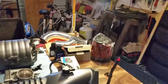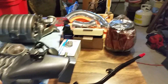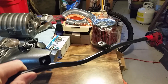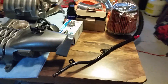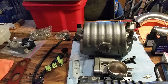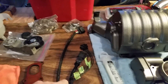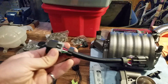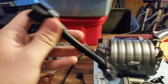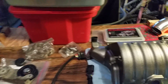There are some things that will make your life easier on this build. The LSJ dipstick tube was $25 Canadian at the dealership - cheapest place to get it - and the dipstick level indicator itself is the same so it works with the LSJ one. A throttle body adapter from ZZP is about $25 and saves time on wiring. You're also going to need a MAF extension because the cold air intake is going to be on the opposite side from the factory cold air intake location on the Saturn Ion.